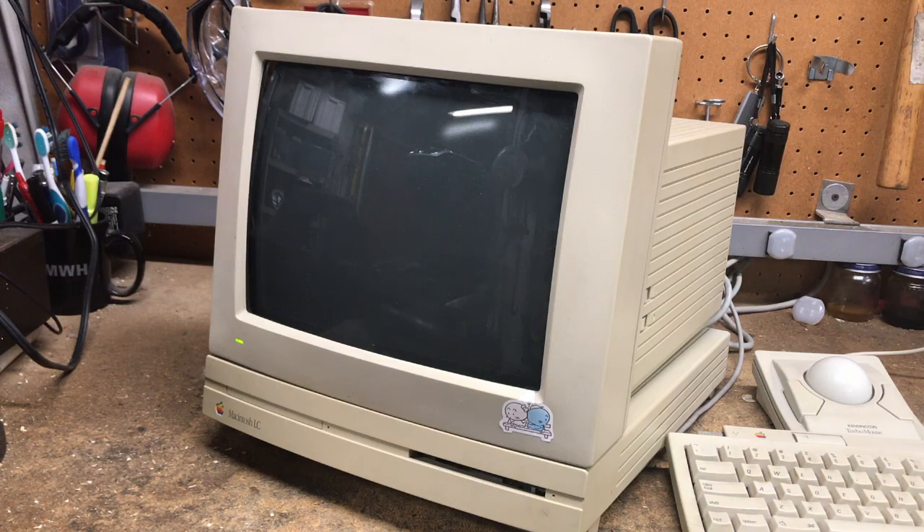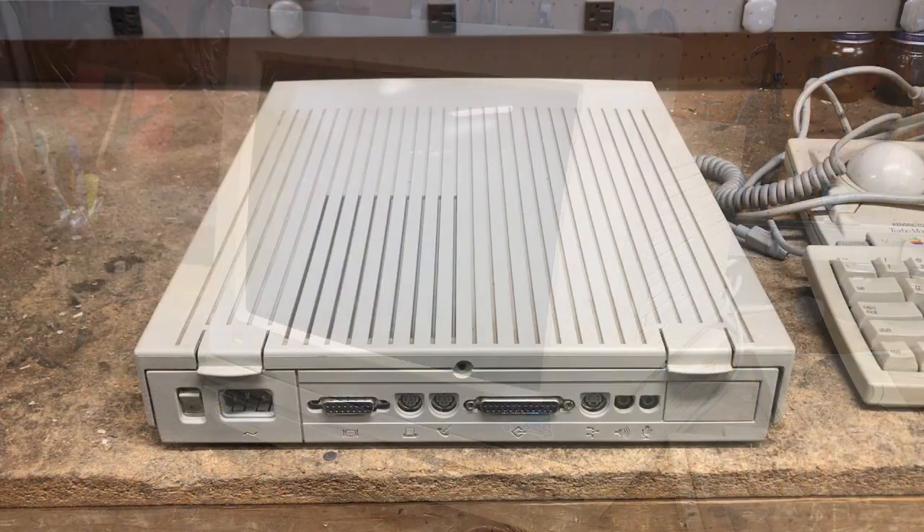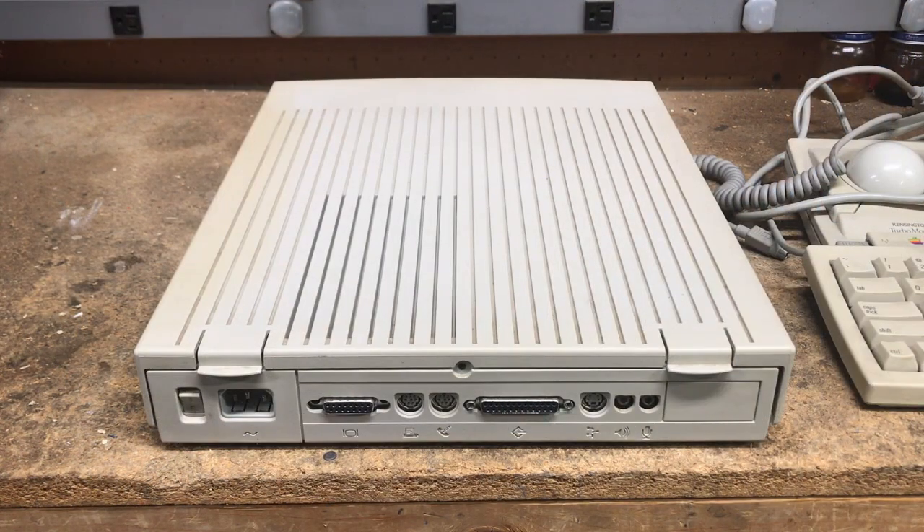I hear some beeps. Looks like we've got to do a little bit of troubleshooting. I'm going to start with the basics. The PRAM battery in this thing is about 30 years old, so hopefully it's as simple as replacing that. The PRAM battery is the parameter RAM — it holds setup and startup information like the date, time, startup disk, and display used. I did try to zap the PRAM on the Mac by holding down the Command, Option, P and R keys during startup, and there was no change in behavior. So let's open her up.